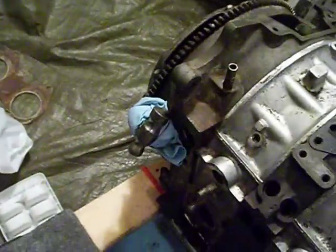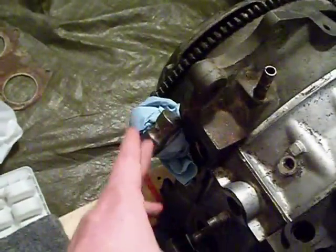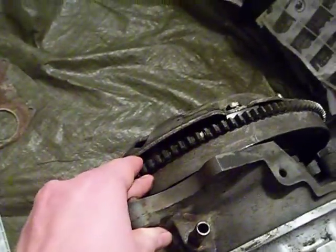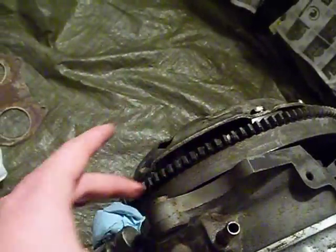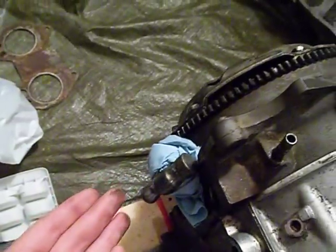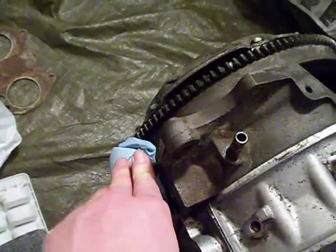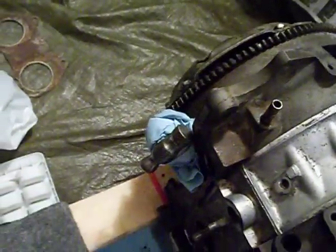However, I don't have that, so what I've done is just taken a small metal hammer and wedged it in here, because the flywheel has a sort of step in its construction such that the flywheel can't move anymore because this hammer has been wedged in there. Pretty simple solution, but it'll work.